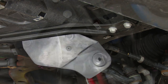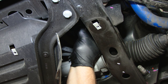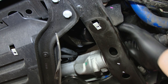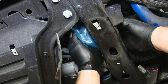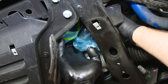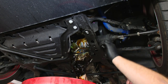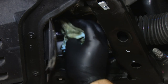Now we can easily get to the oil filter. Depending on who did your oil change last, you might actually need a tool to remove the filter depending on how tight it is, but in our case we don't need a tool. Here's a little trick to make a little bit less of a mess — put a bag around the oil filter when it starts to get loose and then loosen it so the bag catches the oil. Then drain the filter in the pan.